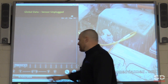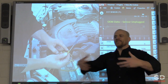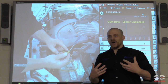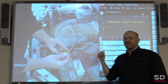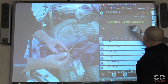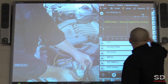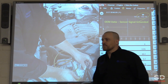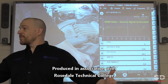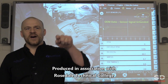But what is the warning? I'm trying to do circuit integrity. I'm trying to use the scan tool. Ninety-six degrees with the circuit open, ninety-six degrees with the circuit shorted — I'm trying to do an integrity test and it is not working. Your first thought might be a wiring problem, but no — you have a substituted value on the scan tool.